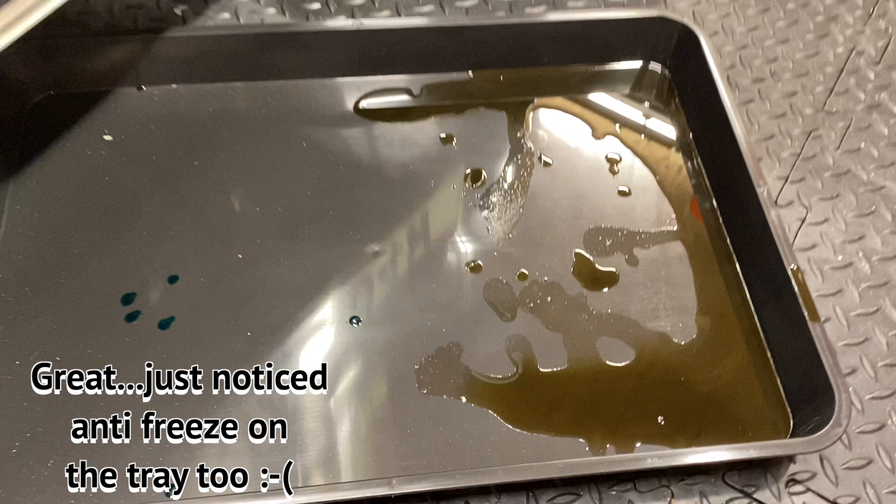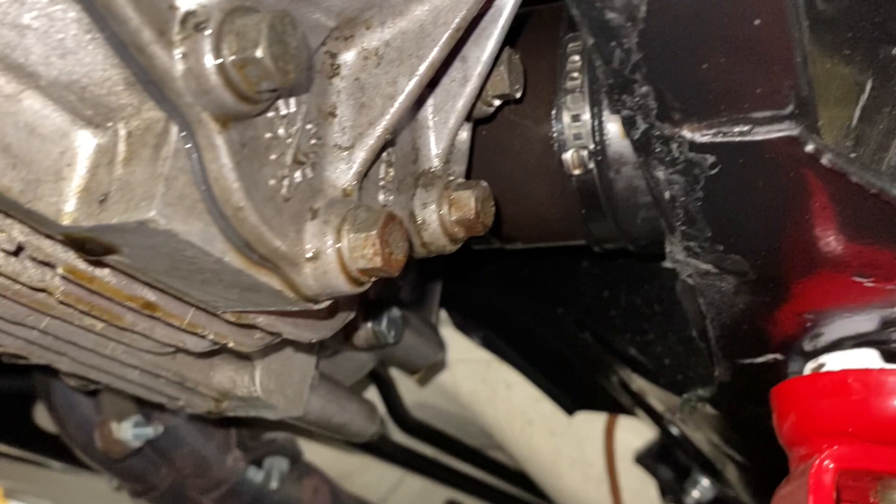But there are a few oil leaks. The fan is covered in oil mist, which may just be from the breather, but the main oil leak seems to be coming from somewhere near the timing chain cover. I'm concerned it may have to be an engine-out job, but that's currently under investigation. The reason for the leak could be a number of things, and I'll leave this until I've sorted out all the other issues as this could be the most problematic.